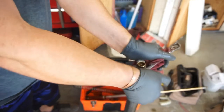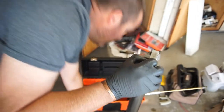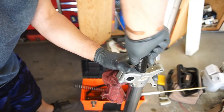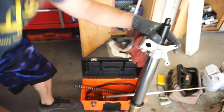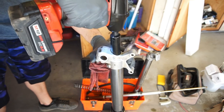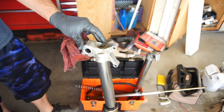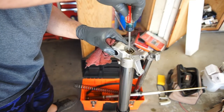All right. Compress it again, take the wrench out, and I'm going to take some tension off, just so I get it started and don't cross-thread anything. Okay. And then this one says 50 foot-pounds. There you go. 75 foot-pounds. Alright, bottom's done, other than my clicks. So I'm going to go all the way in and 7 out.